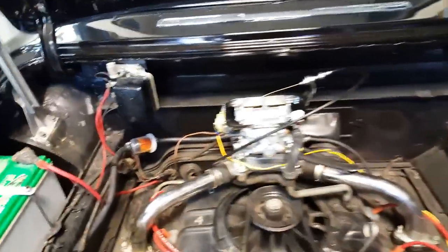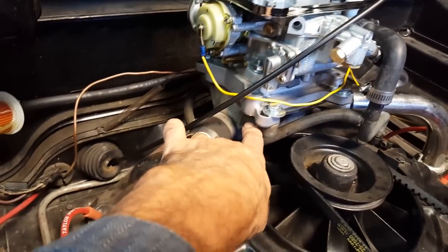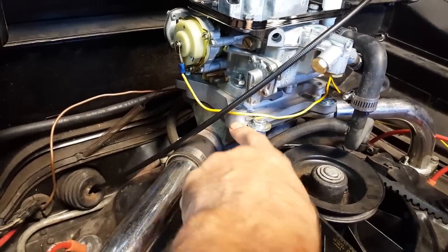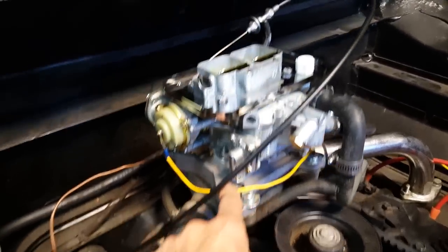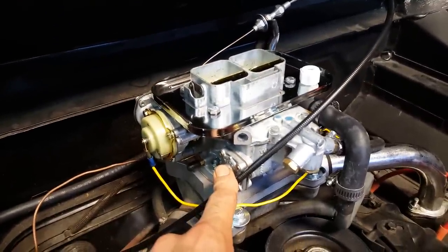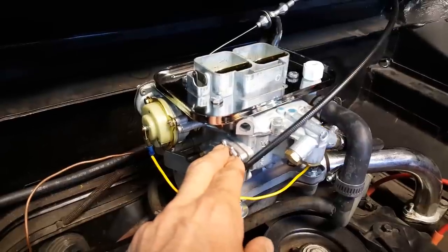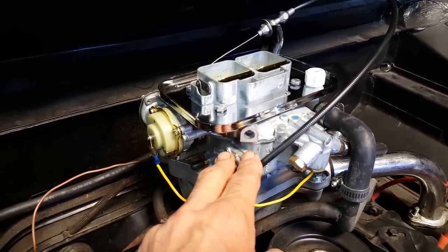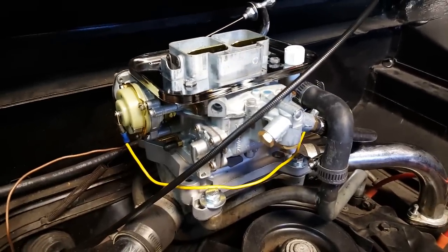What we did is kind of ingenious: I kept the four-barrel plenum — this bottom part here — and got an adapter to go from a four-barrel square flange to a Holley 5200. Then with a little adapting on the adapter, I adapted this Weber DGV, which is a progressive carb. It's primarily a one-barrel, and when you floor it, it goes to two-barrel — approximately 200 CFM, maybe 250.